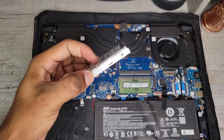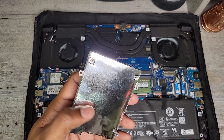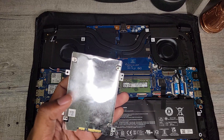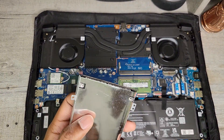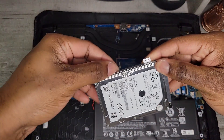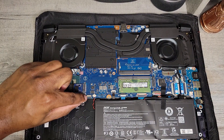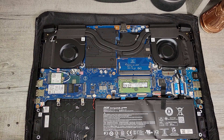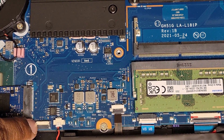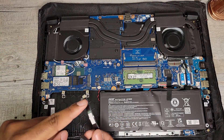Let's grab the cage and place the hard drive into it. The cage is a lot weaker than I thought — in my other gaming laptops they're always solid metal cages. This is the first time I've seen a case like this; it's like some plastic material with a metal coating around it. Now that we've got the hard drive installed into the cage, we're going to install the ribbon cable. This is where you plug it in at this very small port here — there's a little flap that you lift up, and you want to install the ribbon cable with the pins facing down.